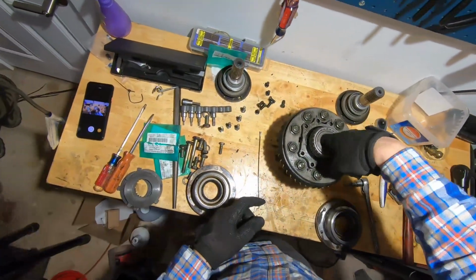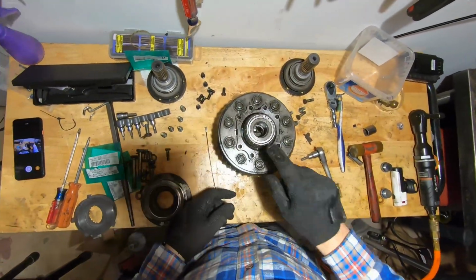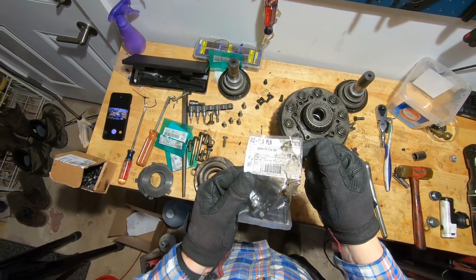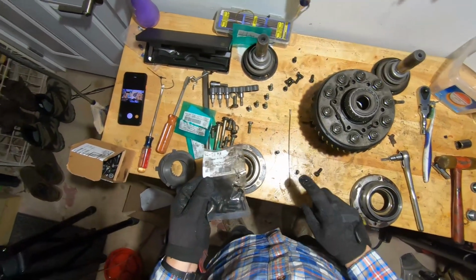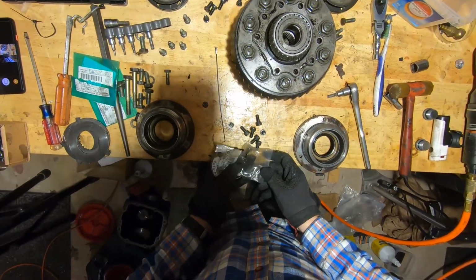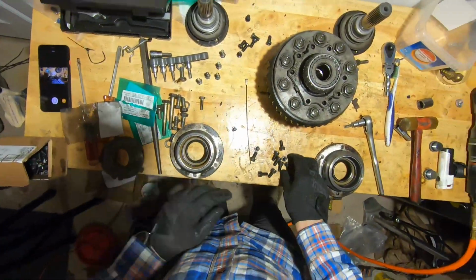I should add, it helps to get a finger in there and hold the stacked washers as you slide everything down. These are your bolts. These are 8x1x16 grade 8 bolts. So we want to replace those so that we don't end up with breakage. I need 8 of these guys. 1, 2, 3, 4, 5, 6. Yeah, that's plenty.